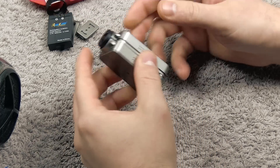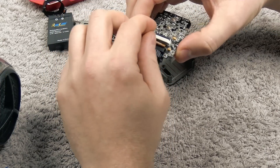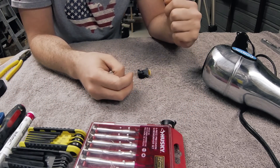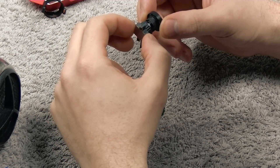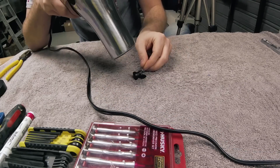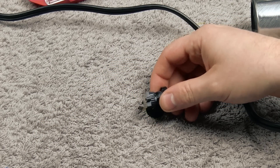To get to the lens unit, no matter what, you have to take out this housing — but if you do it carefully it shouldn't be a problem, it's not very tough. Just don't snag it on anything. Loosen that, and now you get the lens unit. I'm putting all the other stuff aside since I don't want to get electronics too hot. Let's see if applying heat will loosen this rubber glue, whatever's going on, so we can unscrew this thing.